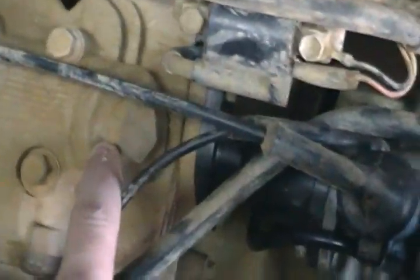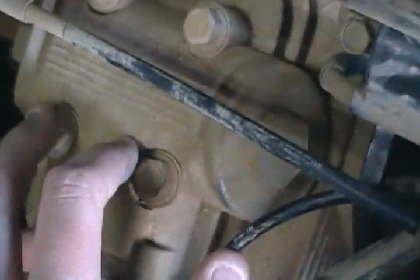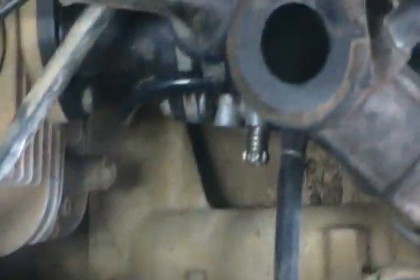This will be your intake valve, because it's closest to your intake, and this will be your exhaust one, because it's closest to your exhaust. You just adjust them. All I need to know is to find those specs on the front and the back, and find out on here what to set it on TDC compression. Once I find TDC compression and find out the valve specs, I might just call the dealer and ask them.